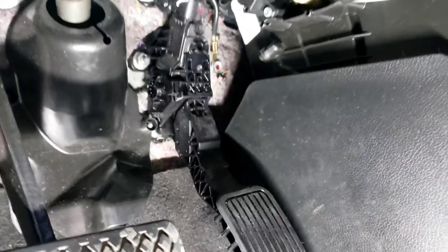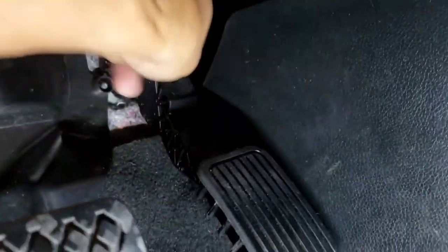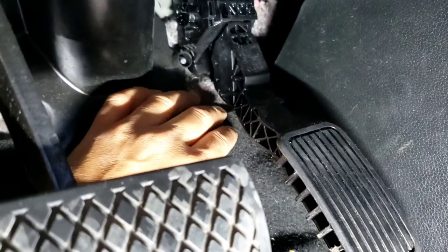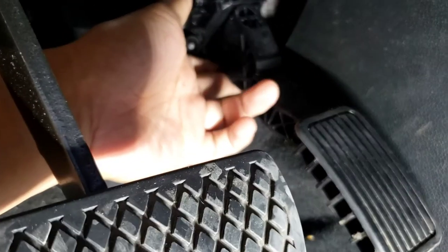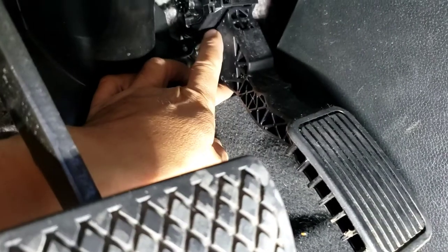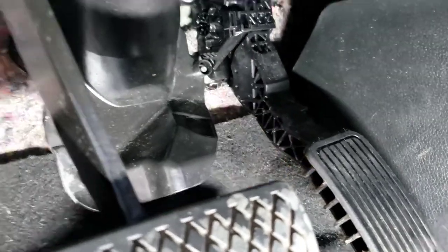Here's on the back of the steering wheel — here's where the gas pedal is, and he ran it through right there. See my hand right there, and go down here. You want to make sure there's no wire or anything like that behind this pedal right here — the gas pedal — because when they step on the gas, it would stop right there, so it might get stuck at 30 miles per hour. So you want to put it down here a little bit and run it through right here.